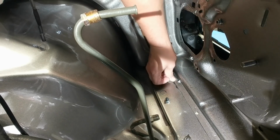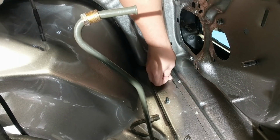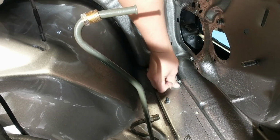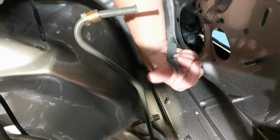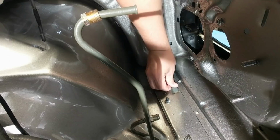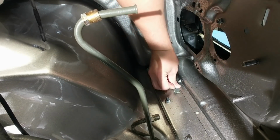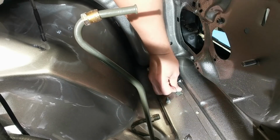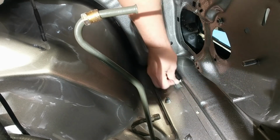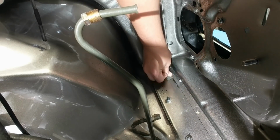I'm just going to let the sandpaper do the work. I'm starting with 1500 because you can always go coarser. And I can see it cutting the paint up. It's hard to see, but it's definitely doing something. I'm going to do this and go back and touch it up when the airbrush comes, and then we'll clear over it again, and hopefully it fixes it.